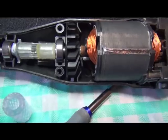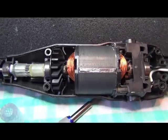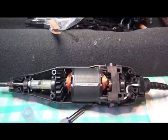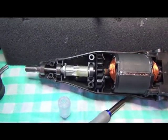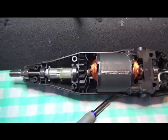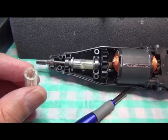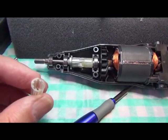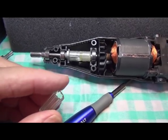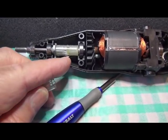The softer original couplers lasted for a while; I think these will last a lot longer. They're $1.48, by the way — so I bought two, and I'll probably never need the second one. I'm not concerned about the epoxy because I can peel the rubber off later if I have to. The drive extension was worn down to a nub, so I end up with basically twice the gripping surface — you can actually see the splines inside it. That gets it back to the original length and grip, which is what it needs.